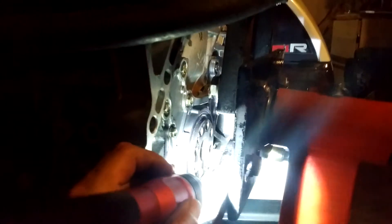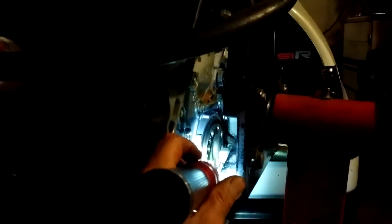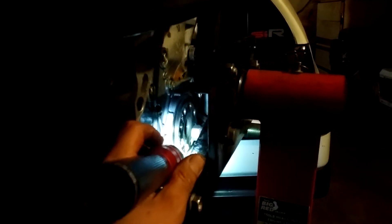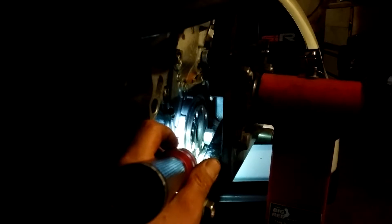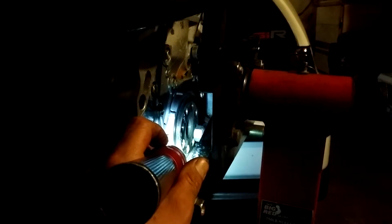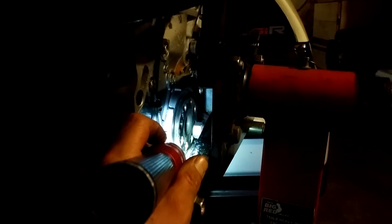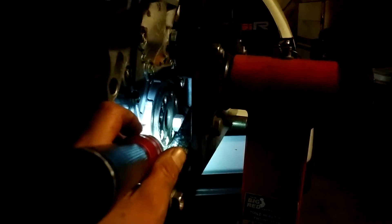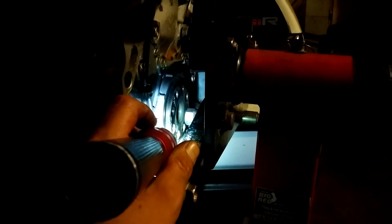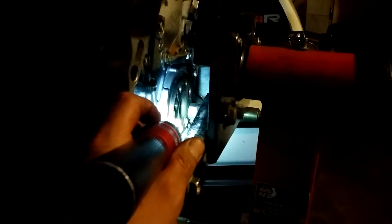This is what I'm really concerned about. When the flywheel broke off because of QSD's fault, it messed up the face of my crank. Now I can still make that work — I can chase the threads and install the flywheel and run the car like that, hopefully until it blows up, and then put together another block eventually. Or I can pull the crank out now and just fix it now, and prep this block so it lasts me longer than a year.